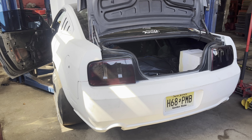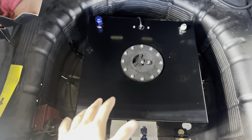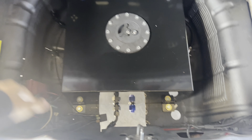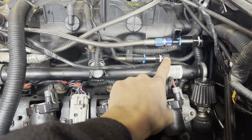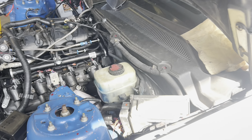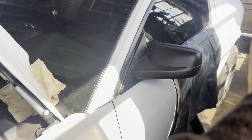Sorry for so many mistakes in that clip. Fuel tank's done, lines are ran. Tomorrow I get the other dash-10 to 8, and then I'll run my return line all the way to the front. I'll uncap the other return line on the factory rail, which is right here — a quick connect to a dash-6 and a cap. So we'll have a quick connect here to an 8, and the rest of the line will follow along with the rest of the system. The system will now be a return system.